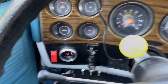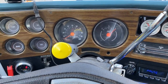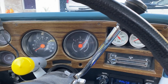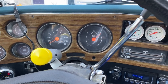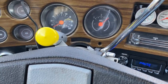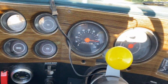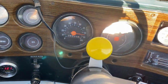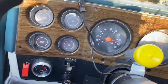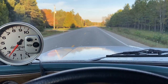Alright, got the truck fired up, letting it warm up a little bit. Air/fuel is reading good, everything's good to go. I'm full of gas. I'm going to head up to the test spot. I'll drive out there and then talk about the issues I was having. Cruising right now at about 55 miles an hour — the speedo says 85 but it's quite a bit off. With 3.73s and 27-inch tires I'm turning about 2,500 RPM. Air/fuel ratio is good, oil pressure is good, temp is good. Once I get to the spot I'll do some explaining and then we'll get to testing.